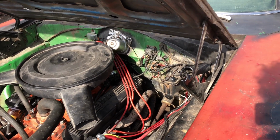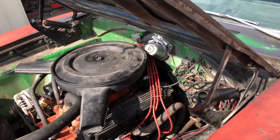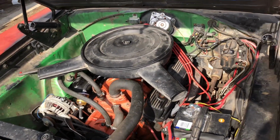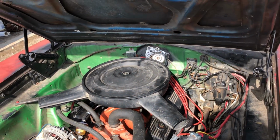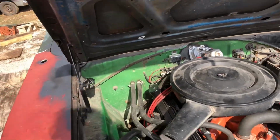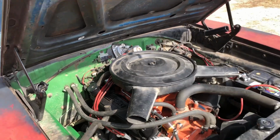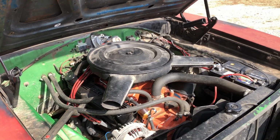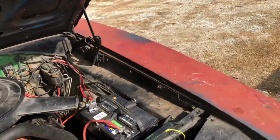And I mean, it was kind of coming around 35 after some mileage on it. And then I usually regap points and clean them up, and it'd fix that. And it probably would have a little bit of problem occasionally, 4,500, and sometimes you can get a real good 6,000 sweep and it wouldn't care. This motor is a strong running motor.